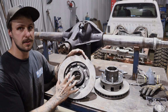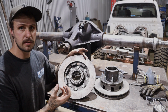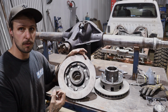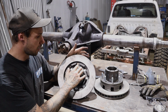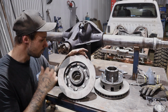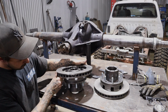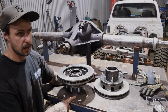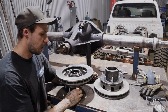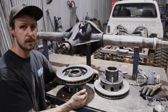Now what you've got to be super careful of is that these studs that are on here, that hole diameter, it's somewhat of an interference fit, and what I mean by that is basically you're pressing it in to a degree. You've got to remember that the internal hub has a spline key in it already, so you don't want to be pressing too much. But pretty well, when I chucked it on the press, I took it to about 5 ton each one, pressed it in nice, completely sealed them all in, and rotated that around. A simple thing I've done, pretty much sit it on the bench like this flat, measured from that hub to the surface here, and it was about 76 mil, something like that. I cut up some tube, and then you fish that over the stud and press down on the tops of that, so it's bedding it through, and you've got a nice surface area here to push against, so that you've not got the potential to spit something out on the press.